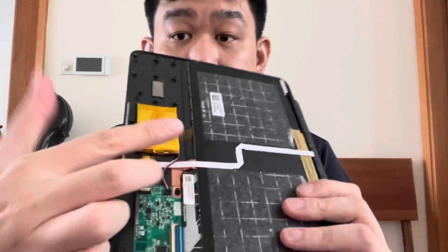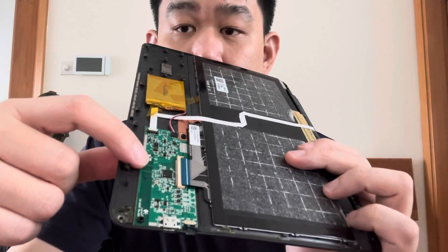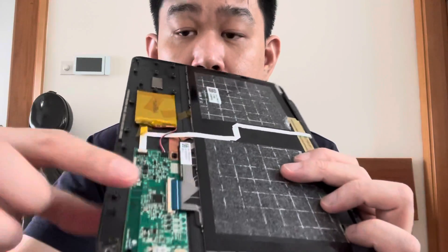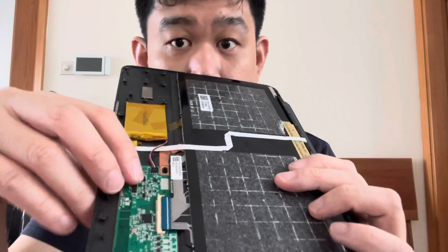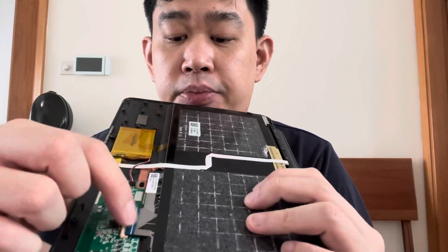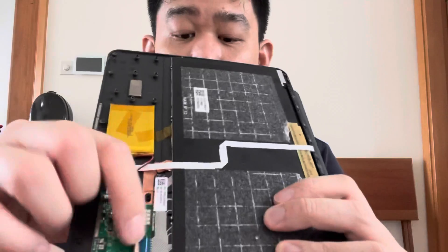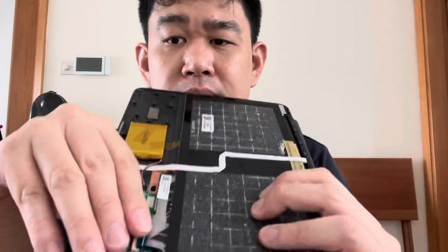I think this is a design flaw. What Logitech should have done is make this ribbon cable flex a little bit, just like the white one — they should have put some bends in it. If the connector were facing down with the ribbon cable going down and then folding back up, that fold would have allowed flex and prevented this problem. As it is, it's precisely fitted with no slack, and even just typing on the keyboard would cause this motion and wear out the contacts.